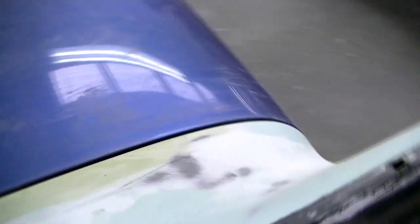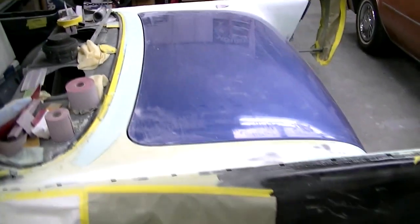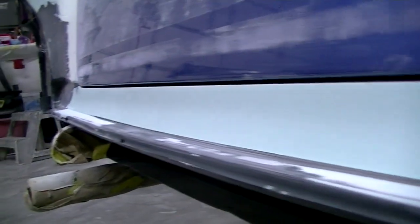I then tape the trunk lid, which you can see there's a little bit of sanding on. I tape the trunk lid, put my DA on it, and move it across that area that I just filled the gap with, and knock that down till it's the same level as the trunk. I come back and back mask it, and then I do my sweep over the trunk and that area that needs to be filled. You can see I've done that here now on the bottom of the trunk lid, completing that where the trunk lid meets the rear body panel perfectly and at the same level. You can see a little bit of sanding on the trunk lid where I had my tape, where I rested my DA as I cleaned up the edge of that area that I filled.